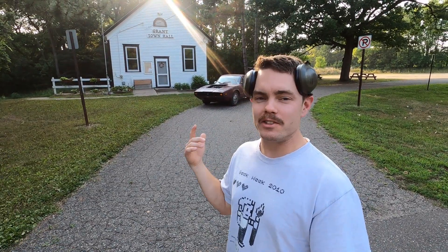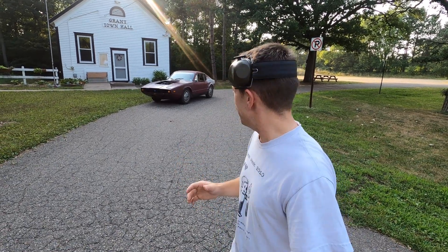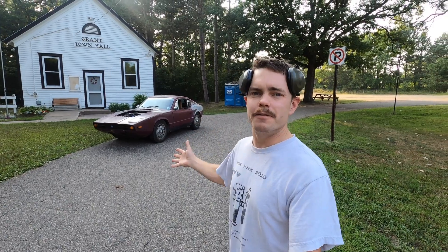Okay, that is an extremely embarrassing end to this episode. I already filmed an outro and was about to buy a new carburetor. It runs so well. I still have some fine tuning to do — I think I might buy a Colortune to look at the combustion flame directly and dial that in. But I'm going to drive this thing to work tomorrow. I can't believe I went through all that effort, but a lot of it was worth it and needed to be done anyway. All I actually needed to do was figure out how to hook up the timing light.